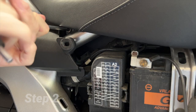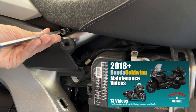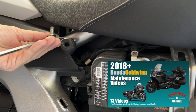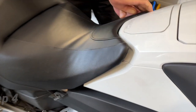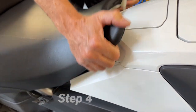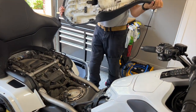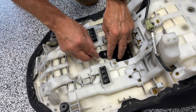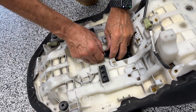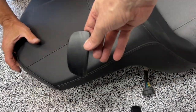Using a 6mm Allen wrench, remove the two bolts on either side of the seat — they're located toward the front in between the frame and the seat. Next, make sure you've disconnected the heated seat plug as shown here. Then, beginning at the front of the seat, begin to lift up and remove the seat, then turn the seat upside down so that we can begin working on it. Locate the seat plug tab shown here and go ahead and remove it. Once you've lifted up on that tab, you can turn the seat over and just pull that little plug out.